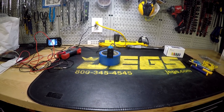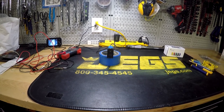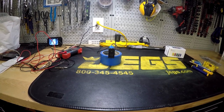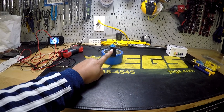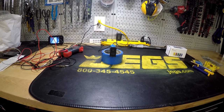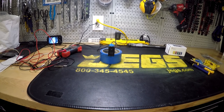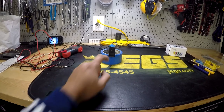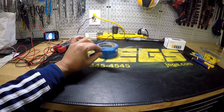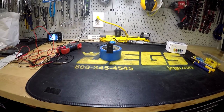All you're going to need for this job is a second-gen 4Runner switch — they actually have a rear window switch as well. You can use any switch, but this one is most convenient because it has the arrows up and down in the right direction. If you get a third gen, the 96 through 98, it's actually upside down. If you go with a 1990 through 95, you'll get this switch, which also comes with a harness plug, making it super easy to install and much cleaner, so you can disconnect it if you need to take off a panel.